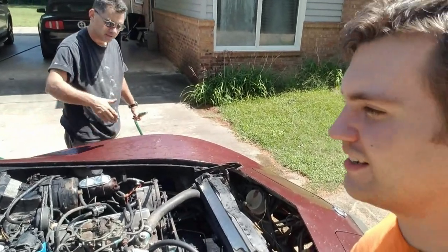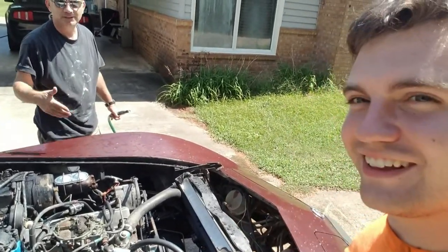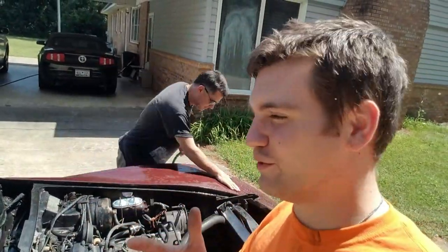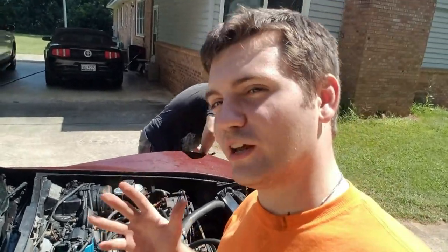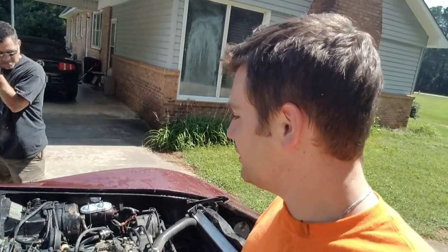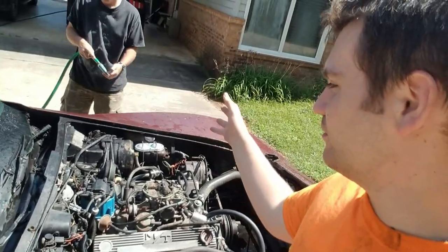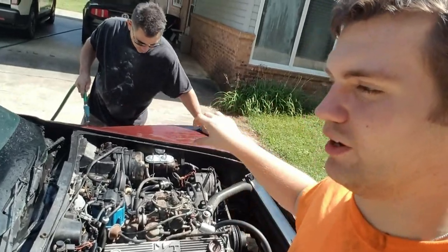I think we should do some wet sanding on this paint and then buff it. It seems like it always gets back to wet sanding. The last two and a half weeks we've been working on this thing, and that's why there hasn't been a video — every time I go to make a video, we start doing something and it doesn't get finished. Usually it's we're going to bleed the brakes, start to bleed the brakes, and it won't bleed. We wound up replacing the guts of the master cylinder. Kind of a funny story — we bought a refurbished one but it didn't have the threads tapped for one of the holes, so we actually just took the guts of it and put them in the one we already had.